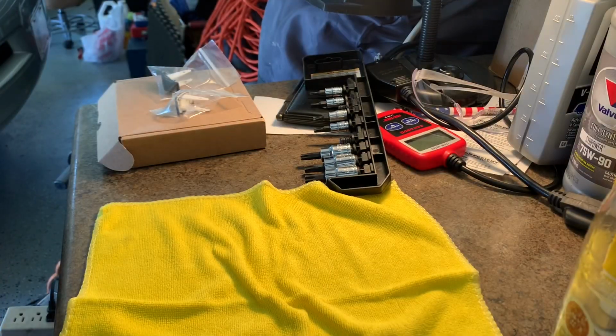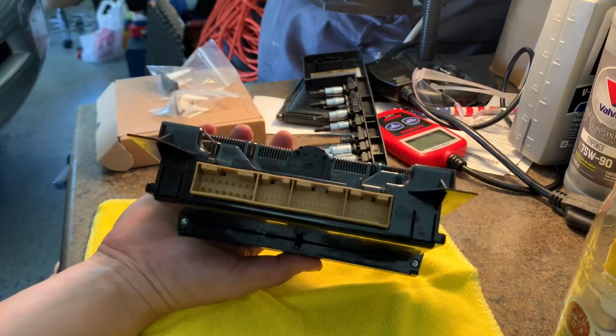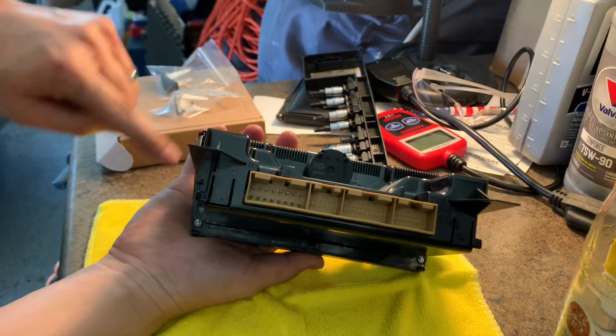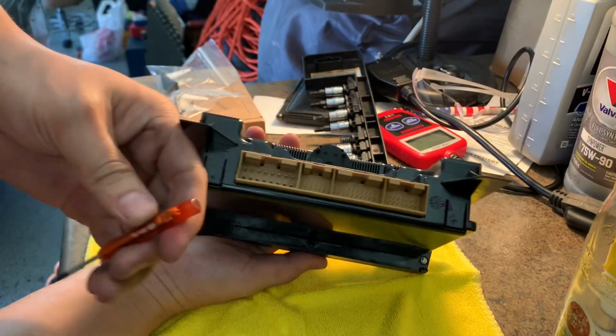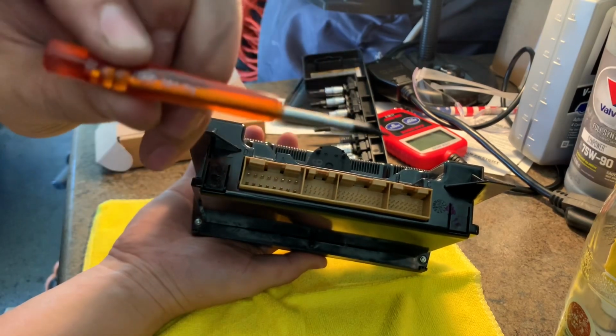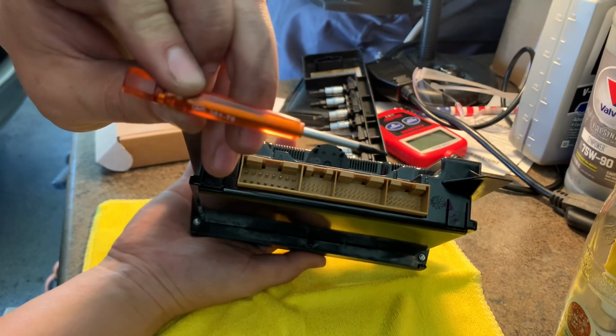So we're now over at the workbench. This is what the unit looks like once you remove it. There's going to be 4 screws you have to remove on the edges. It's just 1, 2, 3, and 4. This was kind of difficult for me because I had to go buy a Torx T6. I'll put it in the description. I don't know if you can see it.